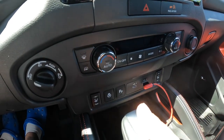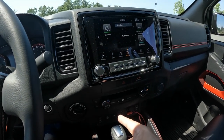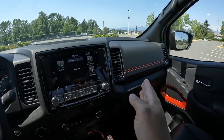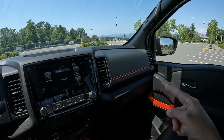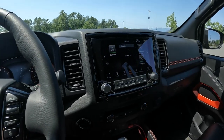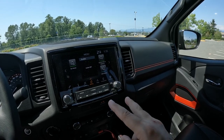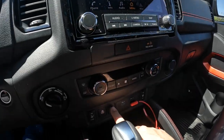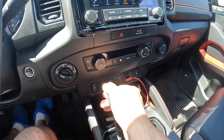When you're backing up, the two outside sensors are not attached to that switch. The reason for that is they are sensing out towards the sides of your vehicle — say you're pulling in beside another car, those side sensors would pick it up every time, especially parking between two vehicles, and keep hitting the brakes since this truck does have the automatic braking system. The two in the middle pick up everything behind you and are what's attached to the auto-brake.